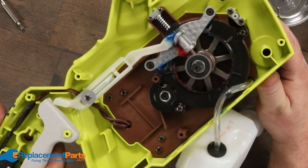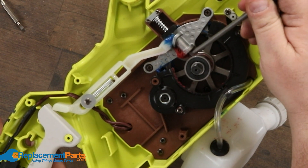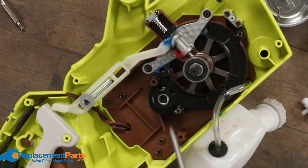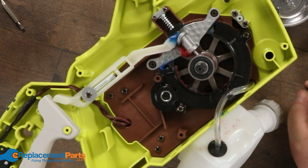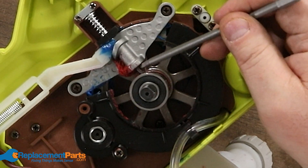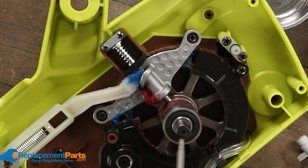As I fire this up, you'll see it spin around — and notice it is awfully quick. Right here, that little arm: as I pull the trigger it comes up, lets the chainsaw spin, and the moment I let go of the trigger it comes back down, hits this steel ring, and brings the chainsaw to a stop. That's something more unique to electric chainsaws — they typically stop almost instantly using an arm like that. For gas chainsaws, they typically have a steel band that goes around the clutch and grabs hold of it, similar to how brake shoes work on a car, except instead of going outwards, these come in and grab hold. Watch that arm — it disappears when I pull the trigger, and as soon as I let go, it comes back and this top portion stops spinning.